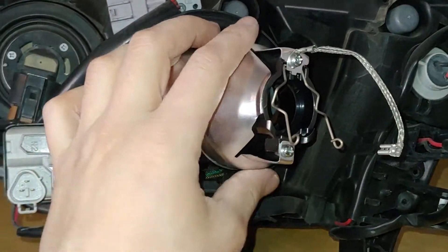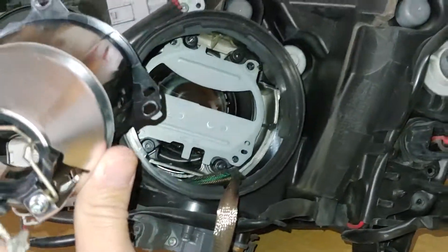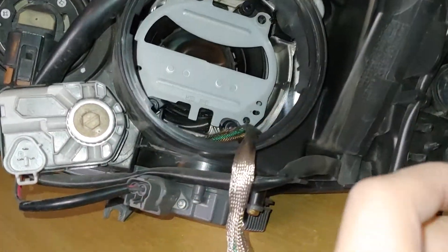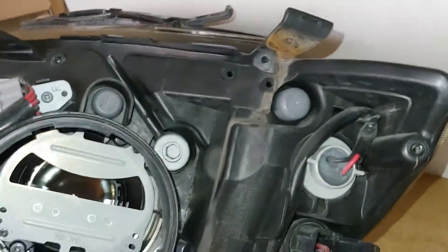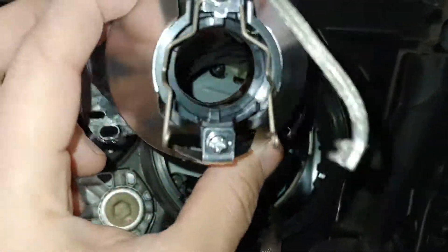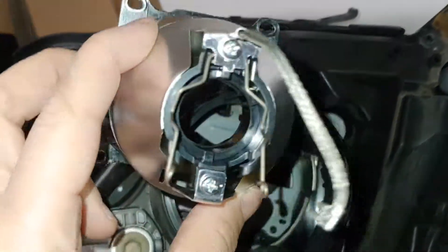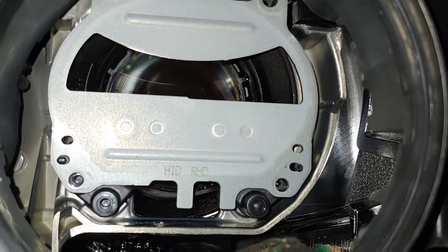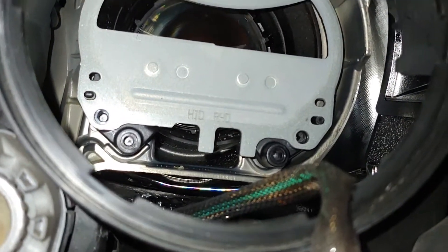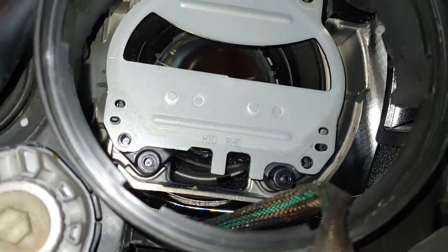This is how to convert your Subaru Impreza hatchback headlights from right-hand drive to left-hand drive. Just open it up, remove this little piece with only four screws, and then you have a plate back there that says right-hand drive — that's for the English, Japanese markets, and Australia.